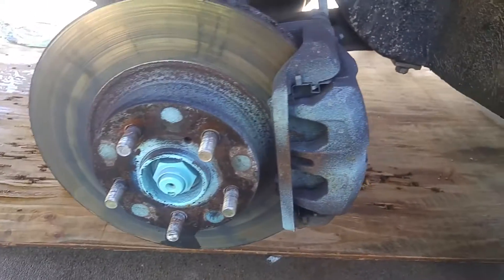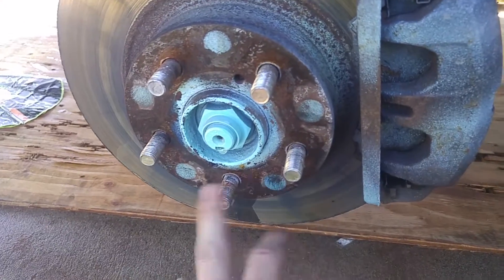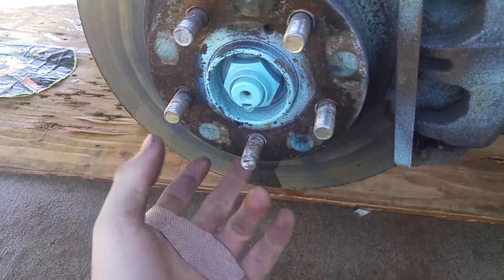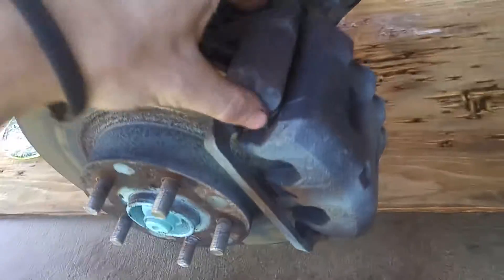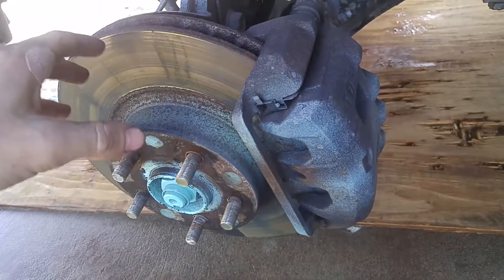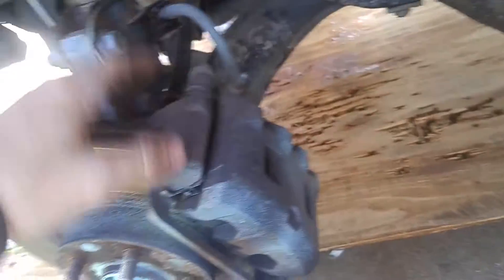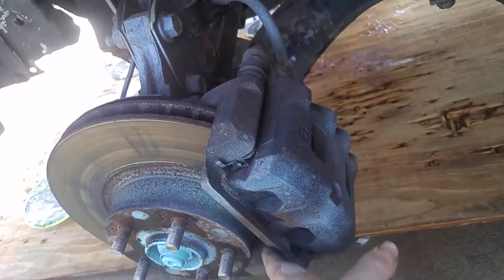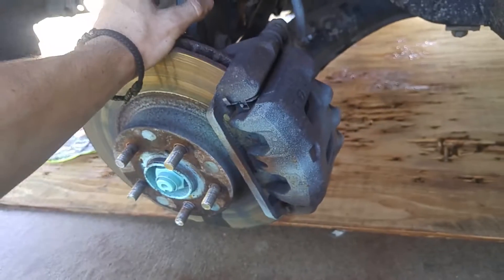So now this is what we have to work with. If you have a wire brush, I recommend grinding everything under here off, because you don't want your wheels rusting to this, especially if it's an older car. We did this at the tire shop, so it's just a little bit of safety. Now we have to get this piece of the caliper off. If you're doing rotors, there's a bolt back here and a bolt in the same place under it — the caliper bracket bolt. Under that you can move the whole caliper off and then you should just be able to pull the rotor off, but we're just doing brake pads. On the back it's different — there's one bolt down here and this is just a pin and it just rotates up. But on this one there's two of them, and I believe they are 12 millimeters, so all we've got to do is break those.